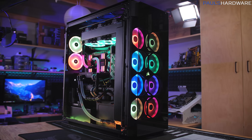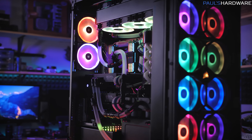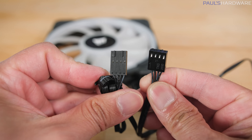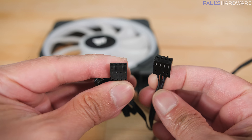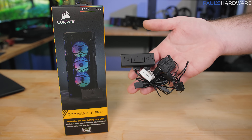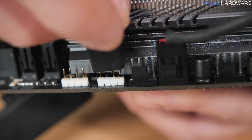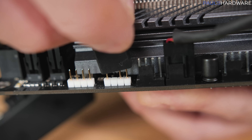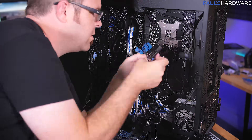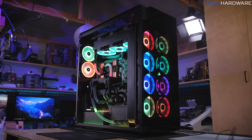With RGB fans, motherboards, LED strips, CPU coolers, graphics cards, SLI bridges, memory, and even SSDs and power supplies, there are a lot of potential pieces of hardware to plug in. And then there's how it plugs in — whether it's directly to the motherboard, to a standalone controller, or to a USB connected hub that needs to be managed with system software. Add the confusion of addressable and non-addressable LED types with very similar looking plugs, and multiple methods of software control that can often overlap with each other, and you can see why skipping the RGB can save a lot of time.